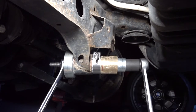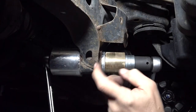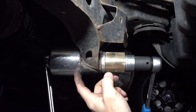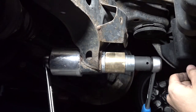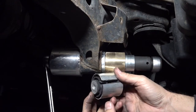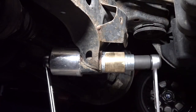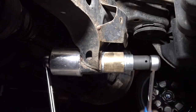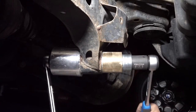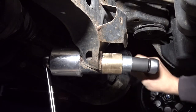I think it's going to work out. There is about a quarter of an inch of the bushing still exposed on this end, so that's how far it still needs to go in. To finish this I've got a hollow receiver cup on the other end so the inner tube of the bushing has a place to go. Let's hope I can get this in and finish at least something today. It centers something like this and I hope it's not too far in.